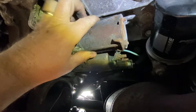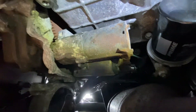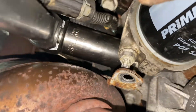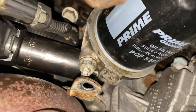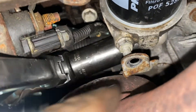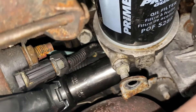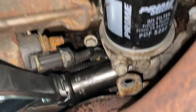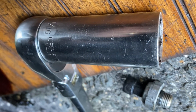Now it's easier to move the starter out of the way to get to the plug. Get to the plug and take the connector off. There's a 13-millimeter nut — take that off and pull the bracket out a little bit so you can get the socket in there. When the bracket is all the way down, the socket can go flush on the back side of the sensor nut — you don't want to strip that nut. The socket size is one and one-sixteenth inch.